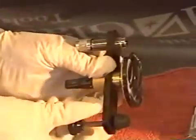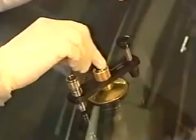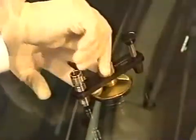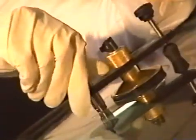Be sure the leveling screw and injector are not screwed in below the level of the suction cup bottom, and place the bridge on the windshield with the injector tip near or on the impact point. Depress the suction cup lever to secure the bridge to the windshield. The brass cap on the suction cup may need to be held in place firmly on different glass surfaces to help suction. Lower the injector base and leveling screw to come in light contact with the windshield.